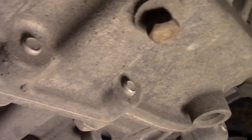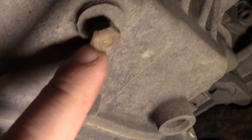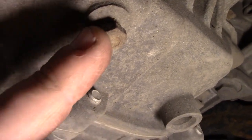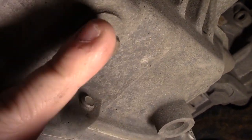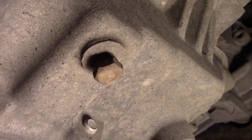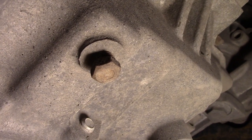When I come back I'll unscrew this — I believe the drain is 11 millimeter, and the one on top I think is 19. It's probably a good idea to open the top one before you open the drain plug, just so it doesn't create a vacuum, and it might drain more fluid.